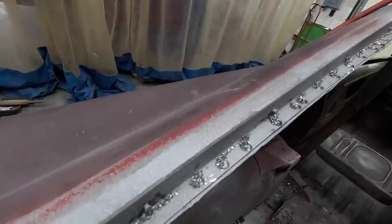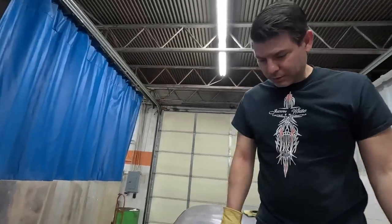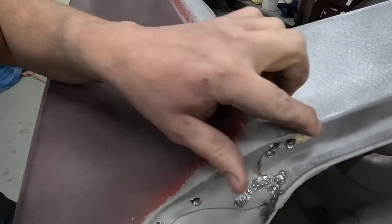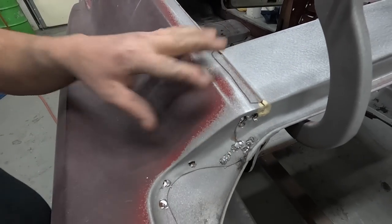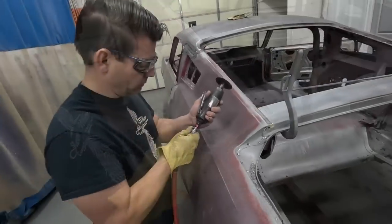So do you think those things are loose now? They'll be stuck a little bit, but if you can get a chisel on them, they'll start popping loose. One final seam, right here where the filler panel meets the quarter panel, they brazed it. So what I'm going to do is take a muffler cutter and slice around this, and we get the quarter off. There'll be spot welds in there. You've got to go back and drill and get that little piece off and clean out this brass.